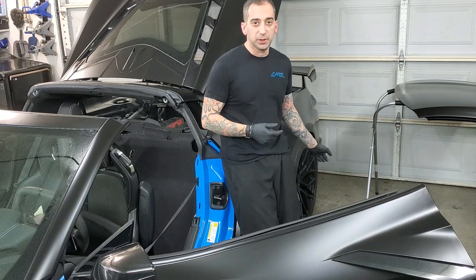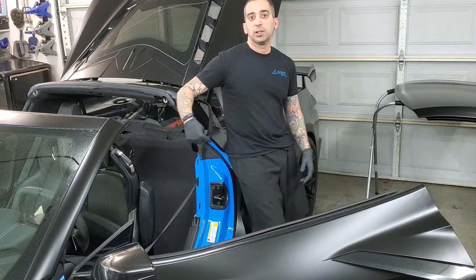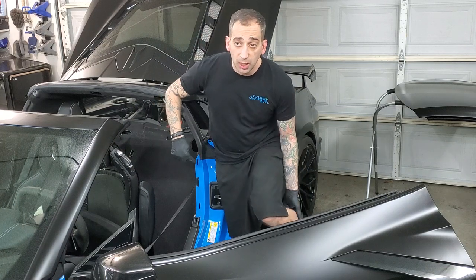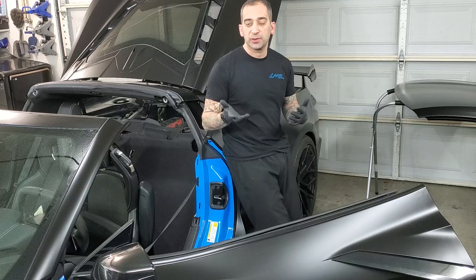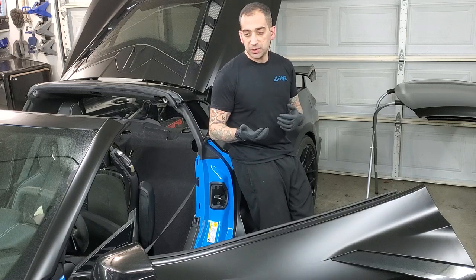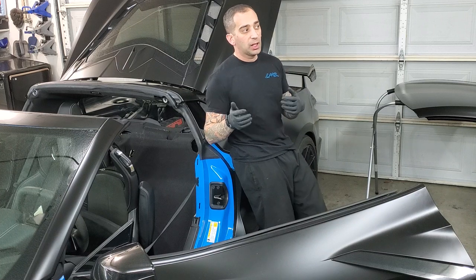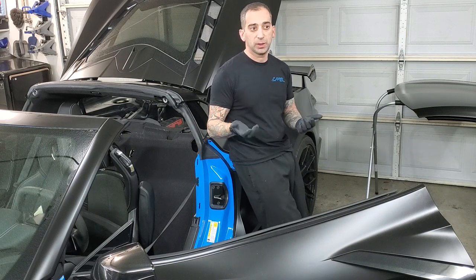Next I'm going to take off the wheel and show you how to get to the back side of that connector from inside the wheel well. You're going to see on the inside of the car there's kind of a white shoulder that goes around it — the black connector has a white shoulder that snaps it into place, and that is going to be the same connector I just showed you. Before you run any wires, I'd say test it with something — use a thin piece of coat hanger or a soft non-marring piece just to see where the wire is going to come through. Also, I'm not actually going to run any wires in this video because I don't have anything to run — no extra engine lights or anything like that. I'm going to show you exactly where it is in case you want to do it.